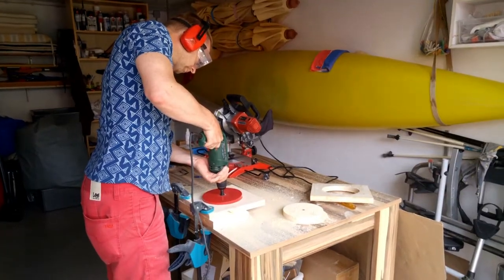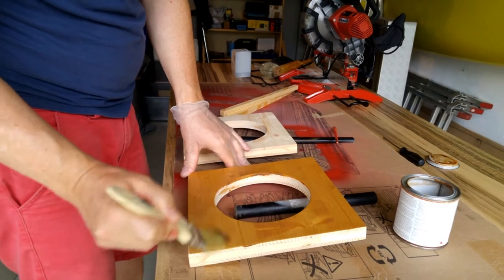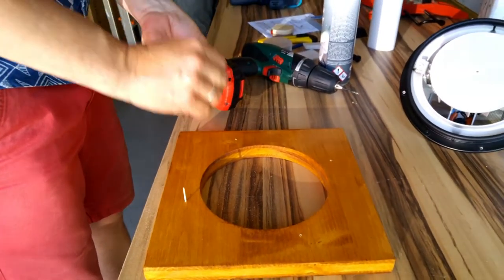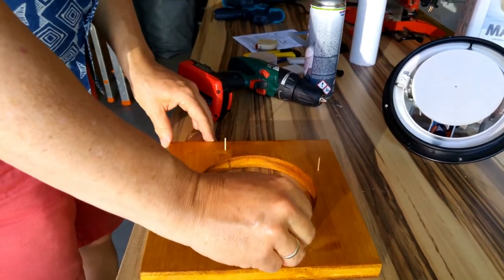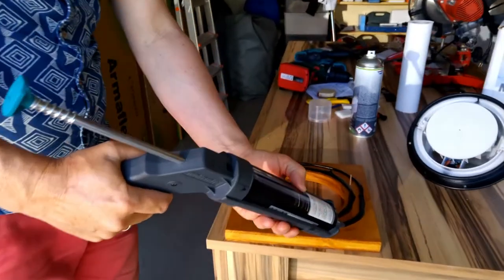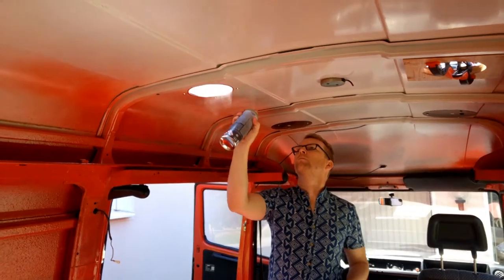Now the edges need some cleaning and of course primer and paint. Inside we need the subframe which I made from a 22 millimeter spruce tree panel which I have already stained to protect against moisture. It's one day later now and the paint has dried. First I want to install the subframe — with these toothpicks it's easy to align the screw holes of the subframe and those of the van roof. I used some sealant for the subframe, which is a second line of defense in case of a roof leak so water can't easily run behind the ceiling panels.